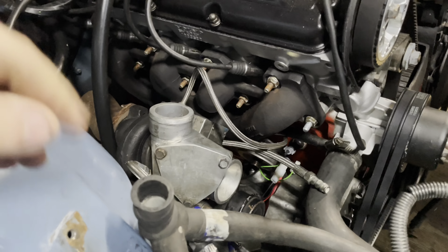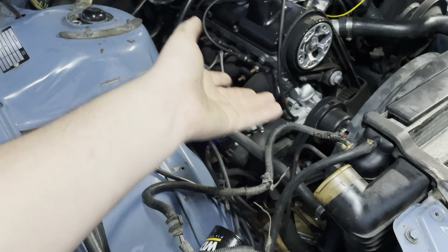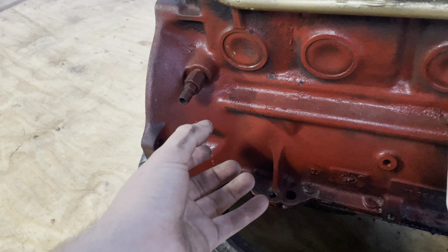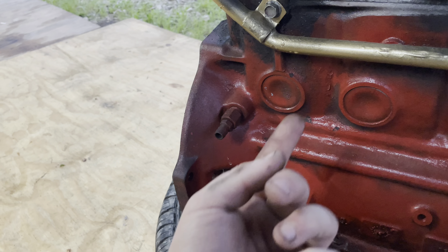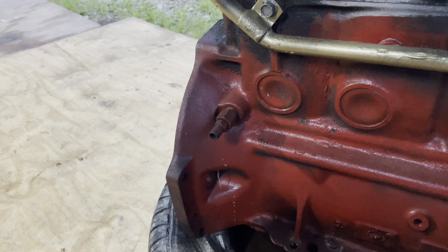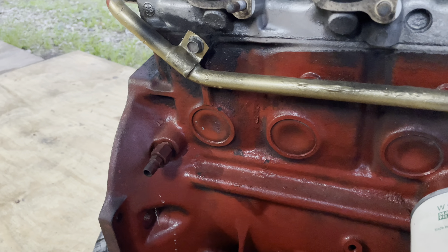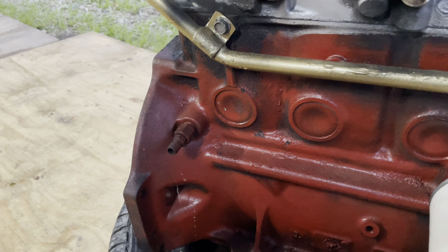That's where it mounts down there — sandwich plate and the filter goes on top of that. I have to pull off the turbo and the manifold anyway, just because this coolant pipe on the 940 — that's what this motor's out of — to run that other oil cooler, it extended the arm way out here, and it had a port in the pipe here and another port here. The coolant comes in, goes into the sandwich plate, and then goes back out. So I have to take this off and put it on that motor. I might just cap it — who knows.